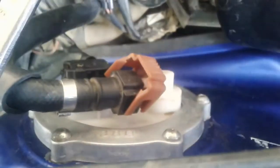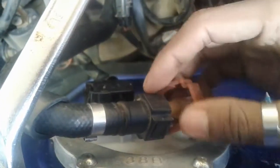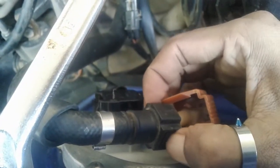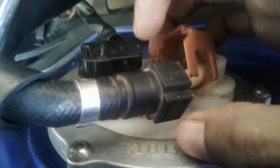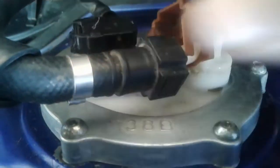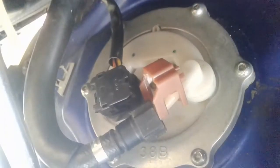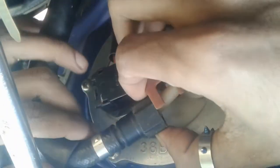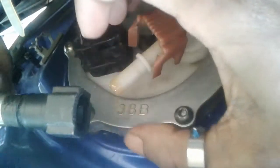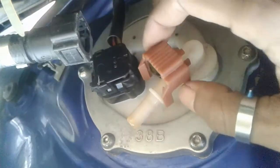This is the fuel connection from the fuel injector pipe. To remove it, remove this red plastic cap from the pipe or it will not let you remove the pipe. Also on this part of the pipe we have two push buttons opposite each other, which we have to push while dragging or sliding the pipe out. To put the pipe back again, just slide it in and close the cap. That's it.